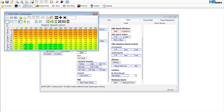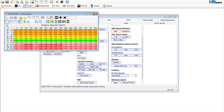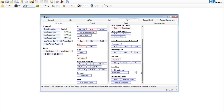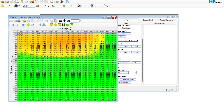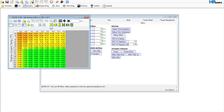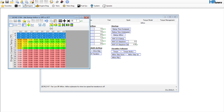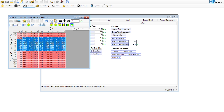Startup spark — we don't want any negative values in here, so we're going to select these last few and set them to 7 — that'll be fine. Not going to touch the over and under speed or the minimum base, not for right now. I do want to go back to airflow — sorry, idle — back to our startup airflow. We probably want to mimic in this idle startup airflow table what we're commanding in our base running airflow. We might go right here and command 13, and up here increase to maybe 21, and then do an interpolation.